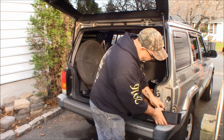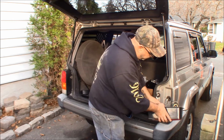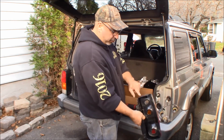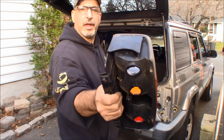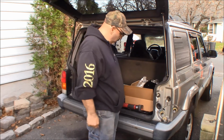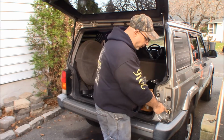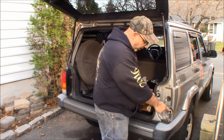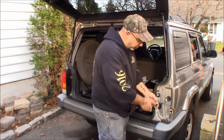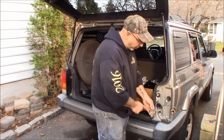Now we can pop out bulbs. Alright, and we got the 3 of them out. And this cracked thing here, I mean, they're still good. They're going to go in the box, they're going to go in the attic, and we're going to hold on to them. So now we got our bulbs here. So you got your top, which is your brake light and running light. You got your middle one, which is going to go in the smoked housing. That's your amber. And then you got your backup, which is right down here, a clear bulb.